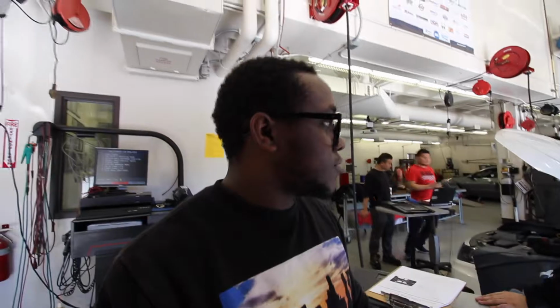Like I said, no cylinder seals 100% no matter what. They all have some blow by, doesn't matter what car it is. They have yet to find a way to 100% seal an engine. So yeah, we're doing good today. We had a few complications and I didn't record them, because at one point we were struggling with the two middle cylinders, 2 and 3, but we got it. Tests are done, both leak down and compression tests.